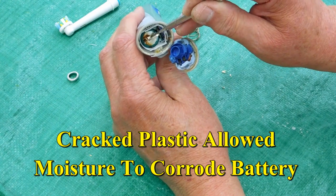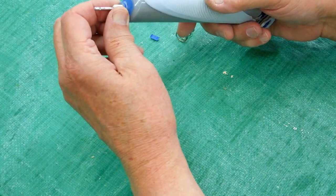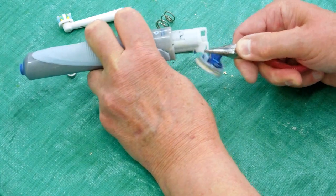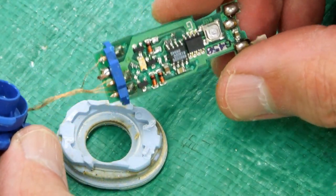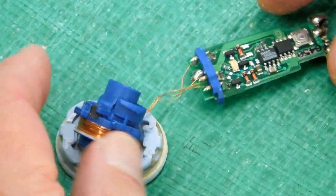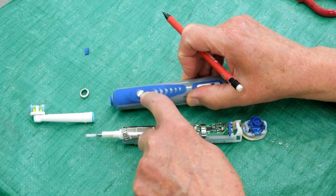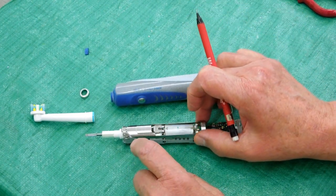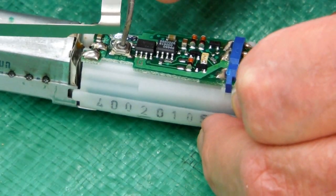The spring was pushing against the battery. I took this little metal end cap off the end here that was squeezing the rubber. There are four wires coming back to the circuit board. There appear to be two coils in the base of the unit, which is the inductive or magnetic charging for the battery. When you push the button here to turn it on and off, you're actually pushing on this long arm for a switch — the switch is actually right here on the circuit board.